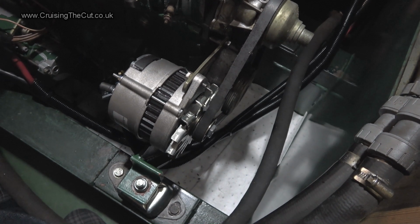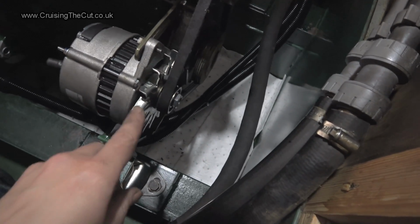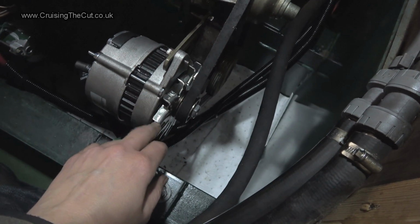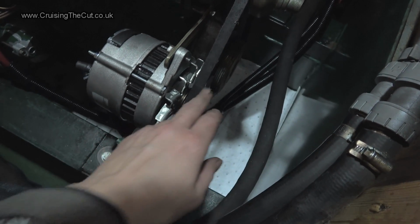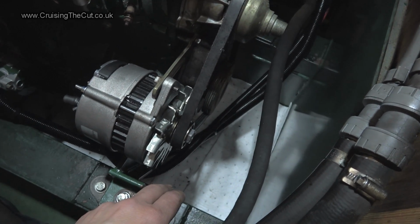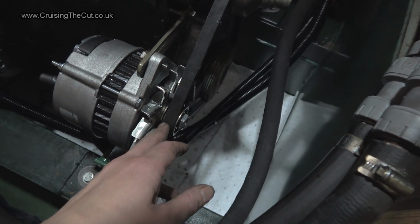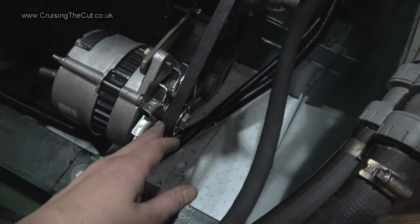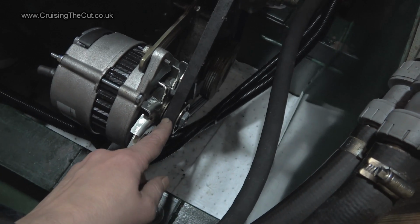About half an hour later, and here is the funny noise update. I got a person in for a second opinion, and we certainly could hear a ringing noise coming from the alternator, like a sort of metal against metal, as if the fan here was making a funny noise. We wondered whether the alternator belt was too tight or too loose, so we mucked about with changing that for a while, and eventually worked out that when I was swapping the pulleys, there were a couple of spacers on the new alternator that were for the slimmer pulley, and I took them off. But in fact, one of them should have stayed on.